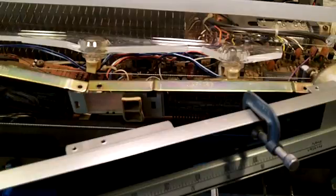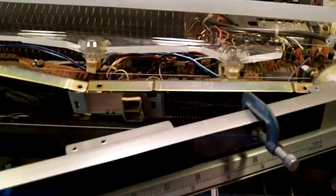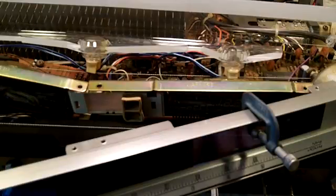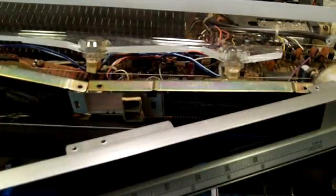Rather, I should say the lack of a dial pointer. And to my surprise, I found that there is no dial pointer — I don't know what happened to it, but it is just not there. When I took this all apart to work on the dial pointer, there's a blue plastic filter behind that which kept falling out. I tried to push it back in without re-gluing it, but in the end I had to re-glue it, so I put a little clamp over it to add some rigidity while it set up. That was done the first day and it's had a day and a half to set up, so it should be good.